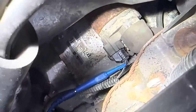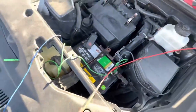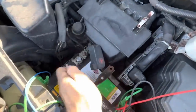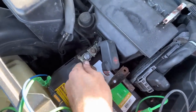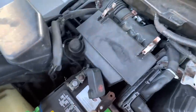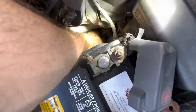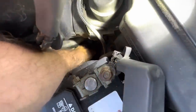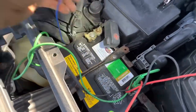You see, I've plugged that connector back into the solenoid, and I have back probed it with that blue test pin. See that? So what I'm going to do is run this blue wire straight to battery positive. And it should, must not be making connection, hang on. It should attempt to make that starter turn over. But I don't think I'm getting connection on my pin. Back probing can be a little dicey. It's not working.